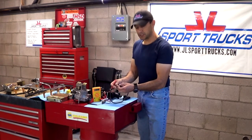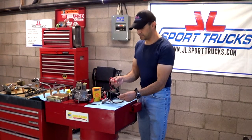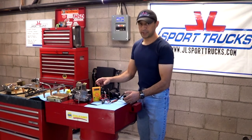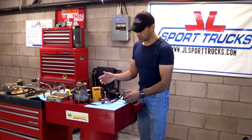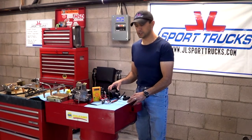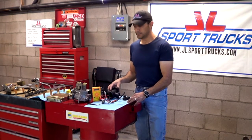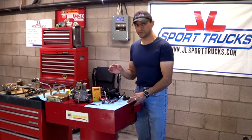With the sensor connected, you would hook your positive lead. When the vehicle is running, you're going to see the voltage signal change. It's going to range from 0.1 to 0.9 volts. The desired fuel mixture is usually 14.7 to 1, and when that desired mixture has been reached, the voltage is going to be about 0.47 to 0.5 volts.